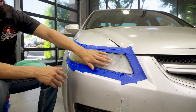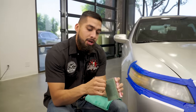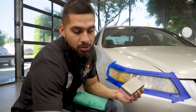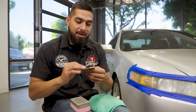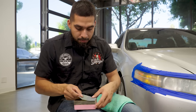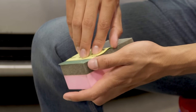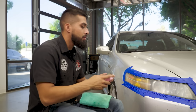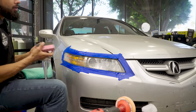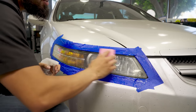Next we want to refine the finish using a lighter grit sandpaper, so we're moving on to 3000 grit. Simply peel off the old sandpaper — you can also have a secondary sanding block so you don't waste sandpaper. This one has adhesive so I can set it aside and reuse it if needed. Same exact method: peel off the back, attach it to your sanding block, press down so it won't fall off, then remove the remaining backing and attach it. Now we'll do the same process with 3000 grit — re-spray the headlight thoroughly with water and use plenty of water; it's better to be safe than sorry.